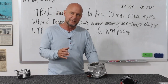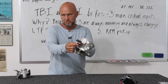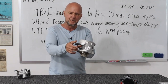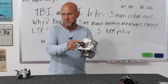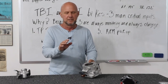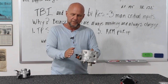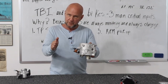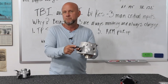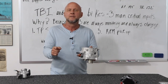If it gets too lean — I could take this thing when I was building this little billet crankcase pressure sensor holder here to avoid issues with these things — because they like to leak where your stock pressure sensor goes into your flexible little rubber hose. It's a big area for leaks and awkward running problems. But if I took this and moved it too far away, it would radically change the pressure that this thing picks up.